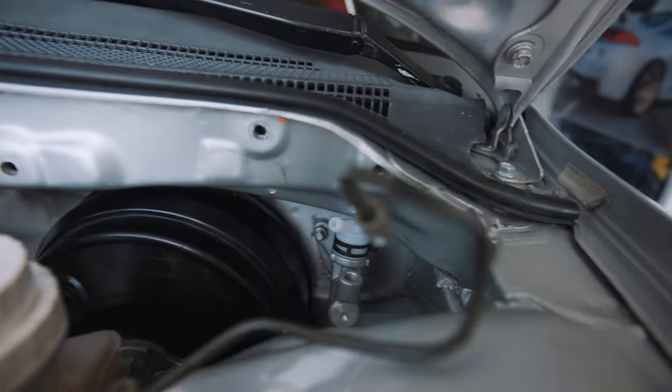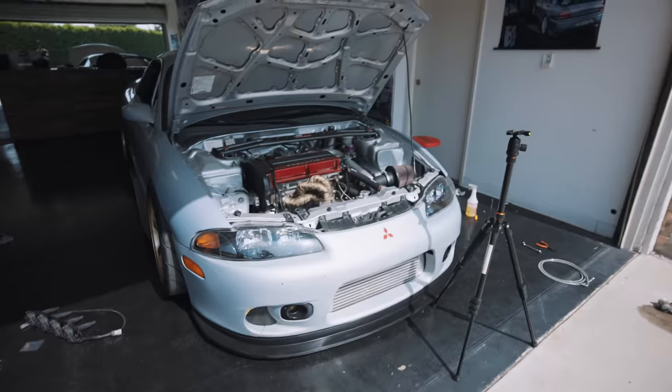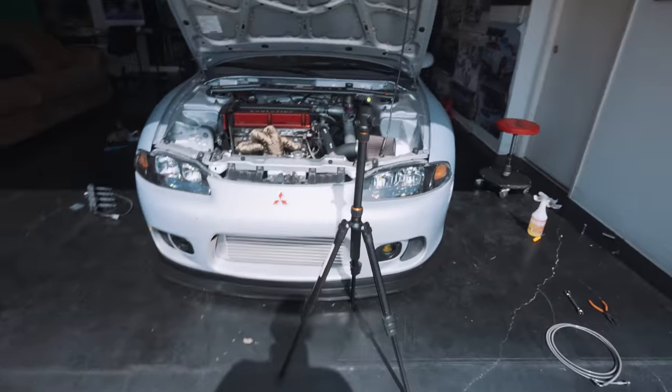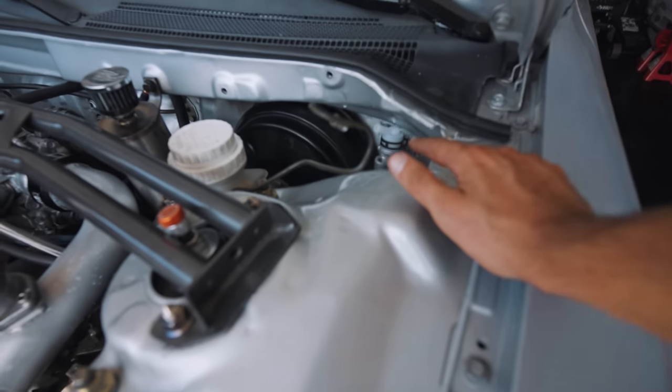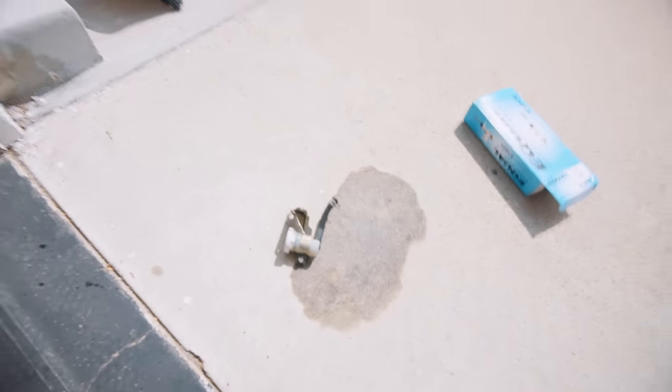She's on on the outside. I went ahead and put the cotter pin back on and tightened that nut. So 30 minutes later, we're officially done. One conversation I have with a lot of people in regards to doing YouTube videos or filming while working on cars is that it takes up an extra two or three times the amount of time it would have taken you otherwise. I would have probably been done already if I didn't film any of it. But I do want to document everything. It just makes the work twice as hard — you have to take into consideration the audience and make sure you clean everything properly. So at this point the new clutch master cylinder is on there. We still have the hard line to disconnect from the slave. We also have to install the reservoir, which I'm going to clean out. And I do have to wait for Marissa to come over and help me bleed the clutch.